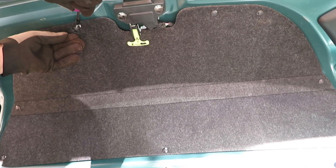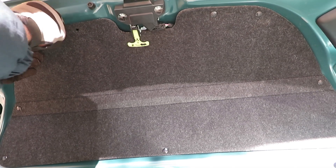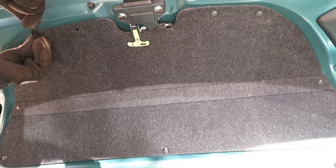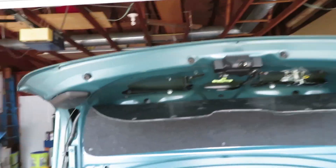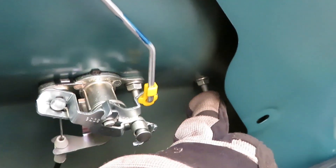The wire is going to go underneath this little cover where the lights are for the plates. Now we're working on the inside of the trunk. There is a liner that's in the way — using a pry tool to pull it out. There are four panel fasteners, and we should be able to bend this down. Have a good look-see as to what is under there that needs to be removed in order to lift that cover up. Now as we fold this down, we can see what we're up against. To lift this cover, we're going to have to loosen and remove some of these 10-millimeter nuts that are holding it in place. There are six of them. Right here is a panel fastener — that's going to be our entry point into the trunk for the wire.